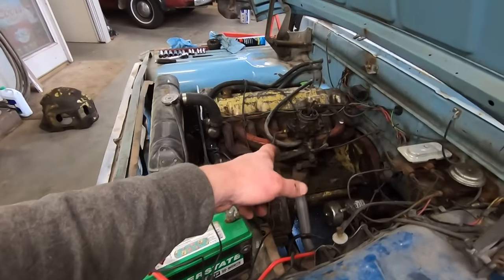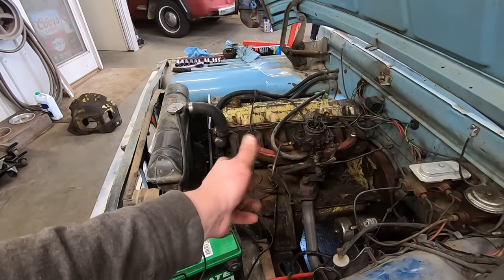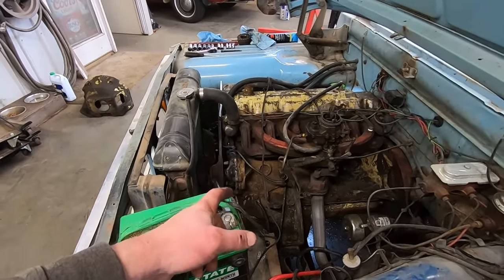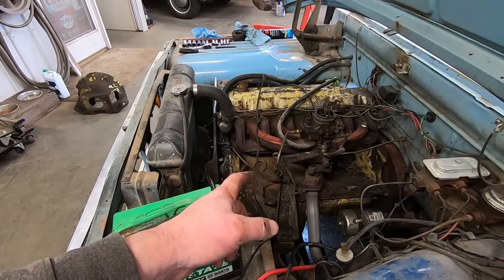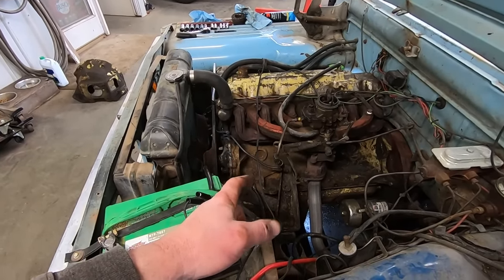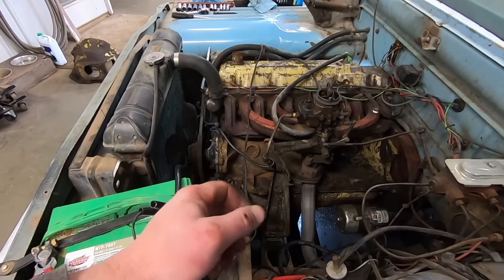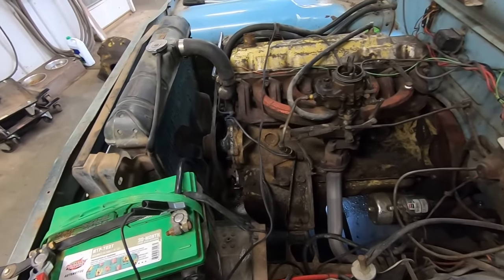And obviously, the lower your idle, it's going to change your mechanical advance in there as well. So we could maybe idle it down a little bit because I think it said 475 RPMs. That sounds really slow for an idle, but whatever. I'm guessing we're not that low. We're probably in that 600 to 800 range. But all right, see what happens.